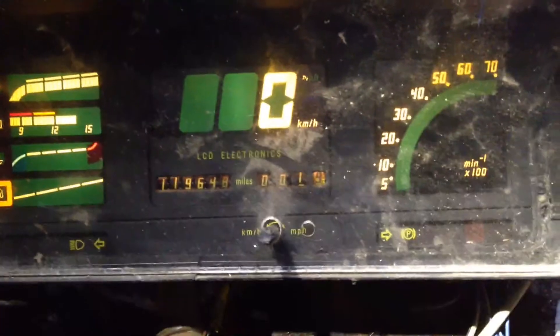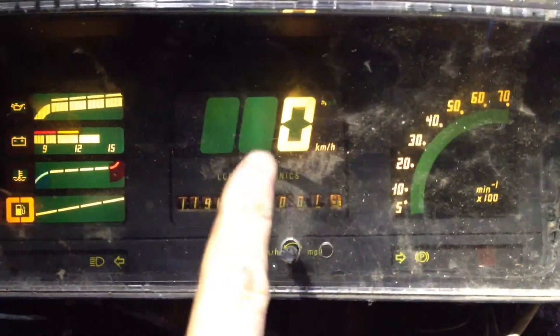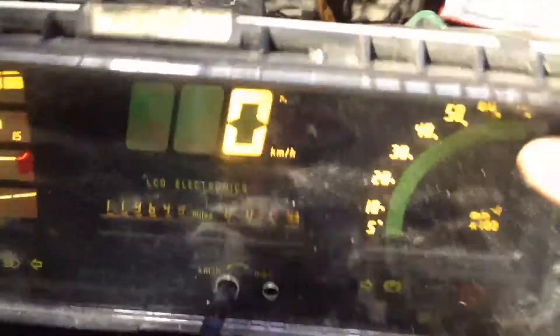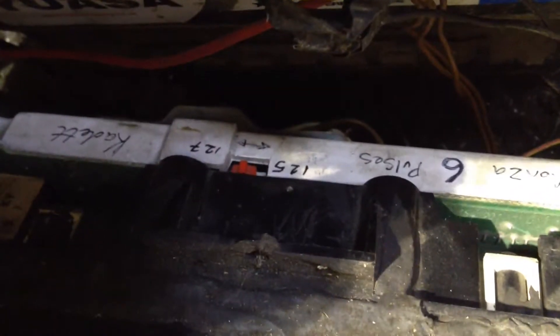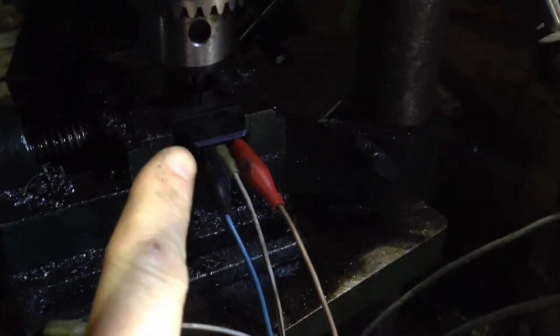Here I am testing the Monza or the Cadet dash. I'm going to test the speedo to see that it's working. If you look down carefully, it's currently in the right outside left position, which is the Cadet — that's 16 pulses. Here we have a Volkswagen Corrado vehicle speed sensor, but it's only four pulses, so I'm going to turn on the pedestal drill and check the speedo.